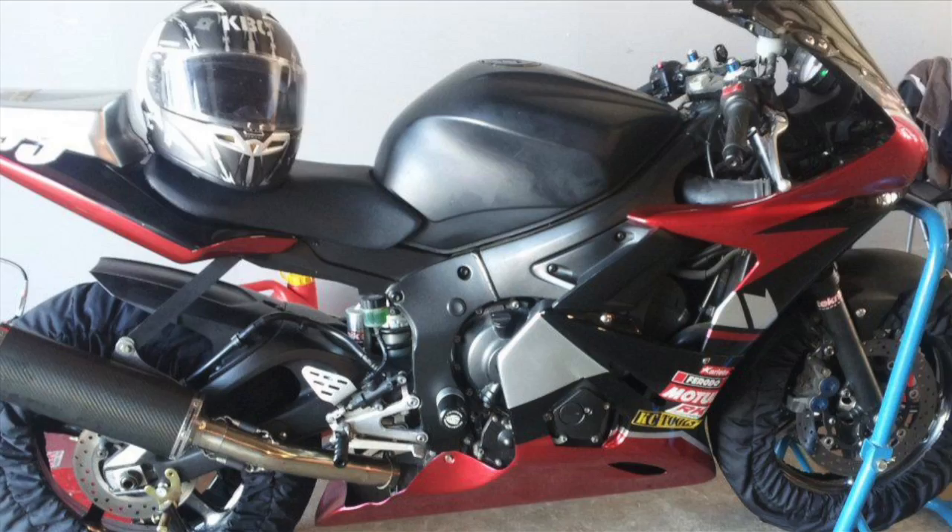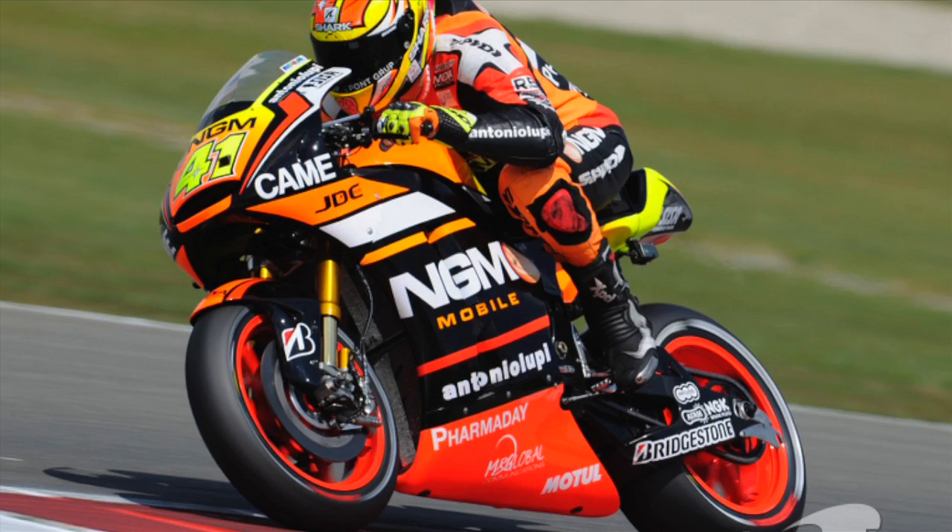I decided to paint my whole bike — the track, race fairings, and everything — not just the tank and the plastic parts. I'm going to paint it in a fluoro colour, which was suggested by someone on my last video, and I picked the colour scheme from the NGM Forward Racing Team colours. I'm a big fan of MotoGP, so I thought I'd give this colour scheme a go. I've cleaned it all with wax and grease remover and I'm about to spray some 2K transparent sealer on it, which is going to help the new paint stick, and then I'll be ready to start my colour scheme.